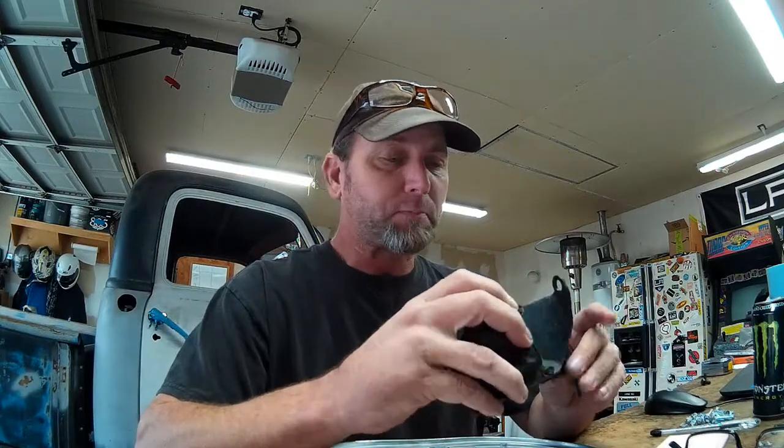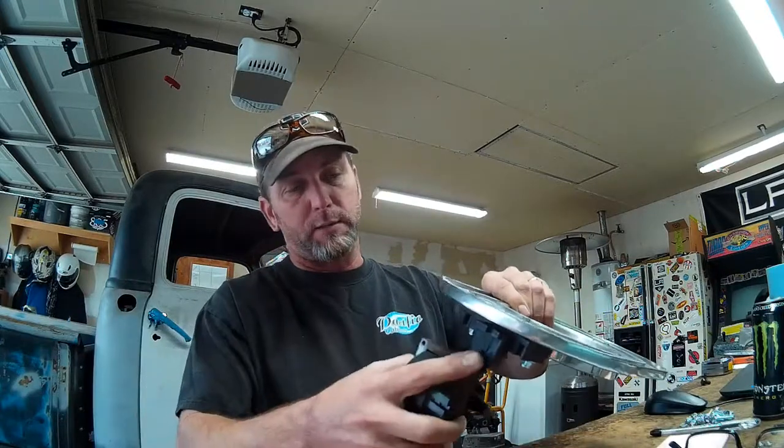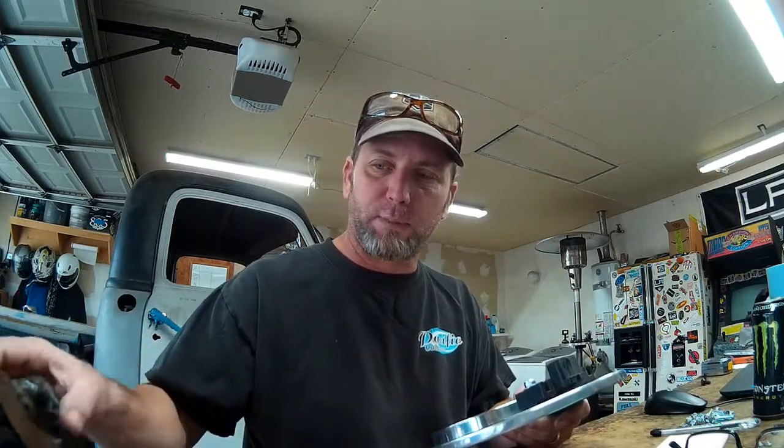So to grant that cable enough room, I had to flip this around and face the coil wire the other way. No real big deal as far as the coil goes, but that caused an interference problem back here at the back of the air filter. There's just not enough room for the map and the coil. So the coil's got to live there. That's just the right place to put it, so that stock coil wire will reach from a stock set of plug wires and whatnot.